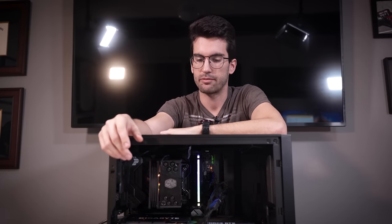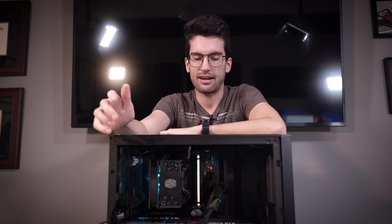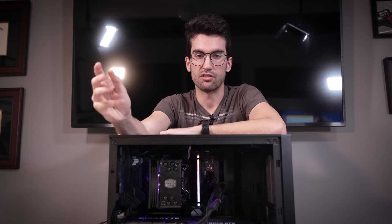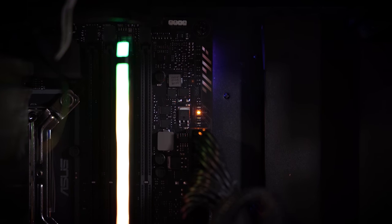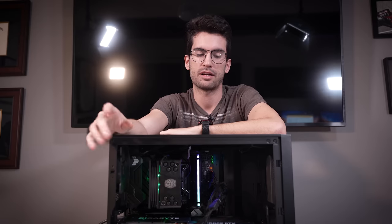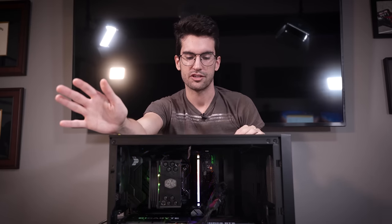I've seen this again multiple times. I know you guys have as well if you've been watching this playlist. I feel like a lot of other issues default to DRAM when you could have, let's say, a bent pin or something along those lines. Maybe that's affecting the way that the CPU communicates with memory. Maybe you have a BIOS incompatibility and it just defaults to the DRAM LED. Some manuals might specify that there are multiple reasons why that LED could be showing up apart from DRAM, but it is very misleading to have that show up for so many different issues.